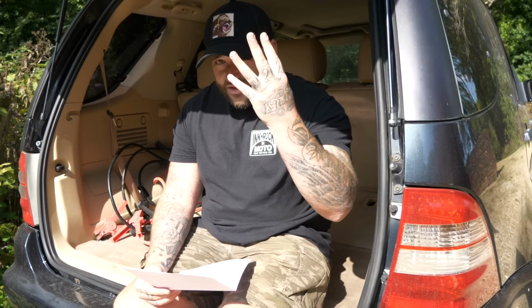Anyway, you saw the state of the cat. There are four cats at the front, so two on the downpipe, two in the center, a box, and then I think there's another box at the back. Anyway, basically, one of those is 100% done. It is dead. As you saw, it was Jubilee clipped to high heavens. That's going to need replacing. Now, of course, you could put a non-factory one in there if you really wanted to.